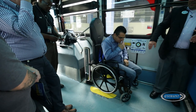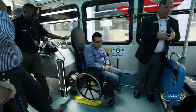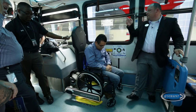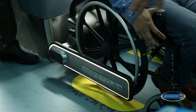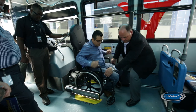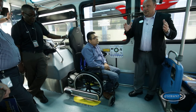See how the chair is crooked — it's not perfectly centered. The Quantum is always reaching and seeking that 50 pounds of pressure. You can see the gap where the arm is not flush with the wheel. Over the course of the journey, as the bus goes over bumps and around corners and the chair moves, it adjusts — always seeking that 50 pounds. It's not going to get looser; it's going to continue to stay tight.